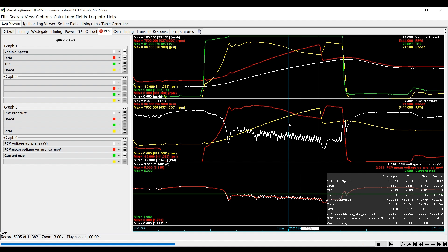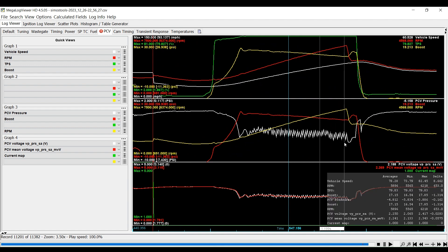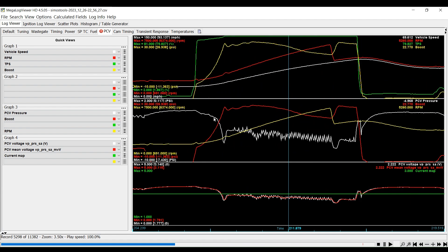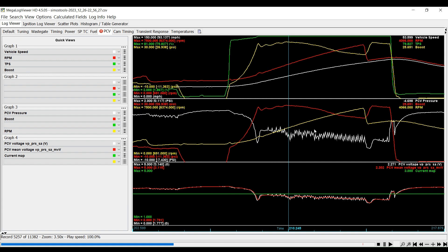So that's about 11 inches of vacuum at wide open throttle. Coming over to one of the pulls with the lower boost map, right here on the lower boost map it's an average of about negative 4.8 PSI, so it's just a little bit lower like we expected. One interesting thing I did notice is that the values for the lower boost tune are a lot less all over the place — compared to the higher boost pull right here, you can see that it spikes way down on the initial spool when it's hitting 23–24 PSI, and then it mellows out and has another little dip which actually coincides with the variable valve lift switchover. So there might be something to fiddle with there.